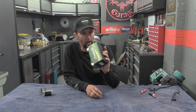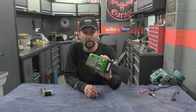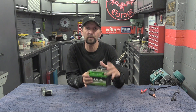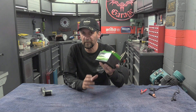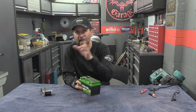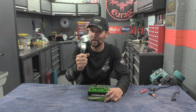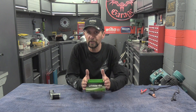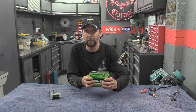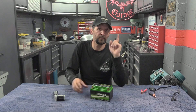So to all the guys at Wiimoto, I hope you're watching. Today's experiment is two things: first I'm going to connect the battery up to a test rig with a halogen headlight bulb and leave it burning for about 15 minutes — wrapped up and insulated as it would be in the battery box — and measure the temperature using a laser thermometer before and after. Then I'll disconnect that and put it on charge using a dedicated lithium battery charger from Sealy, wrapped up for about half an hour, and test the temperature again.